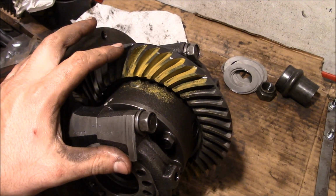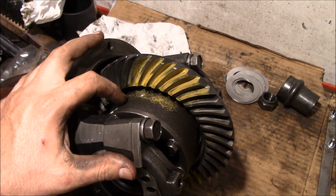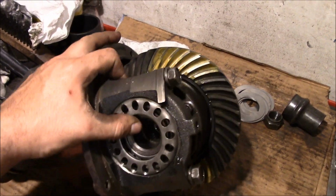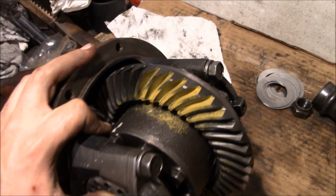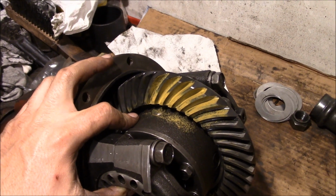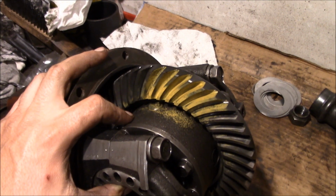So here's a tip for you. Never finish one of these jobs at the end of a long night in the shop. Your acceptance levels have surely dropped at that point. Sleep on it, come back the next day, and then see if you're happy with it. Nothing good comes from compromising with a gear wear pattern like this. It's better to just do it another 3 times and get it right than to call it close enough and, you know, surely regret it.